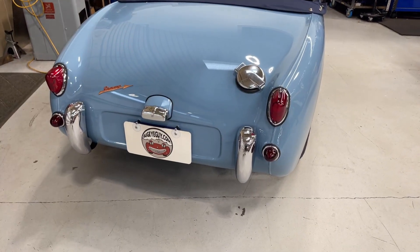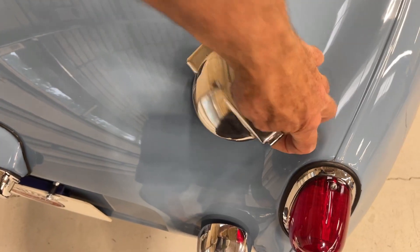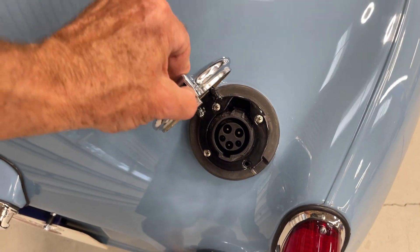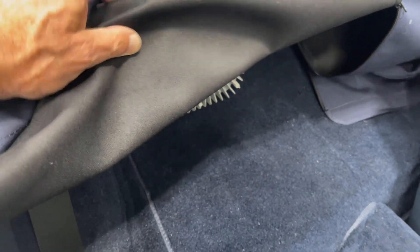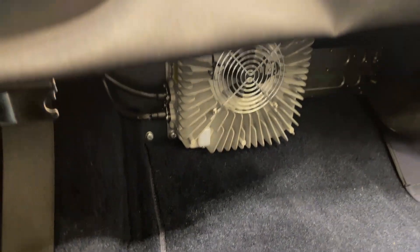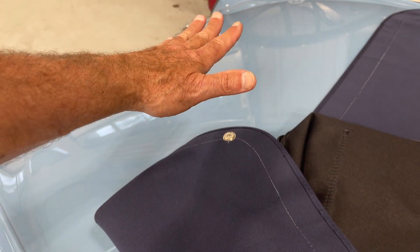Because the car has been customized by owners for years, we feel a little more comfortable doing these conversions. A couple of other really cool things: we custom fit this flip-up fuel cap — this is the 220-volt power intake, so the plug goes here for the charger. The charger is right behind the seat. It takes about six hours when fully discharged, taking the juice from the 220 and feeding it into the Tesla batteries.